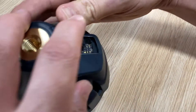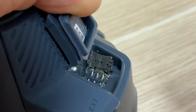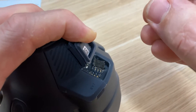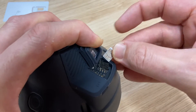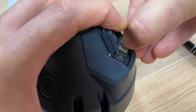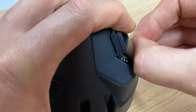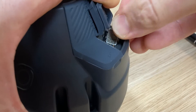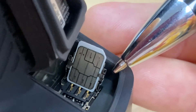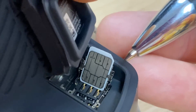Now I'm able to insert my SIM. We've opened up our tray and you can see that printed on the tray is a little indicator of the nano SIM that shows you how the SIM card should be oriented — with the contacts facing back towards me and with the little notched corner of the SIM card pointing up. So we're now going to carefully insert that into the tray. It's a little bit tricky. There are some little guiding things along the side that help to hold the SIM card in the tray once it's in there, so you've got to kind of tuck it in behind that. And you can see those little holders that are holding that SIM card into the tray — that's a good indicator that you've got it in properly and that it isn't accidentally sitting with one side in front of those guides.